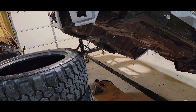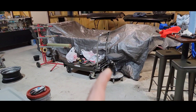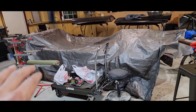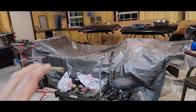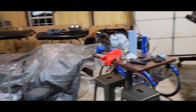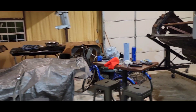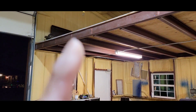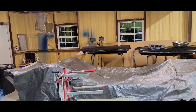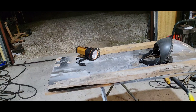Once all that's done and complete with the firewall, I think I am going to go ahead and set the motor and transmission in the car in the frame, and then set the body back on. I'll tape all that up because I want all that done and complete. I'll tape it all up — I love taping and masking — and then start doing my body work. I'm going to take all this old primer back off, all the old body work back off, and redo it all. The doors I never did, the hood I never did. I got the hood up here and a few other parts. I bought so many parts for this car back when I was first starting to work on it — door seals, trunk seal kit, all that.